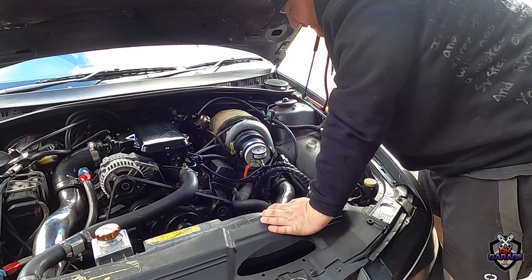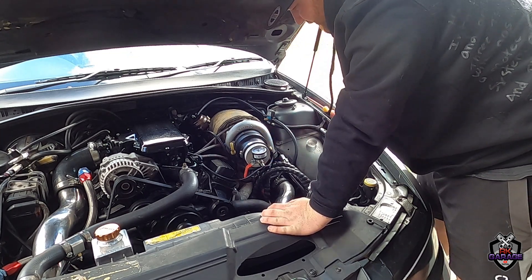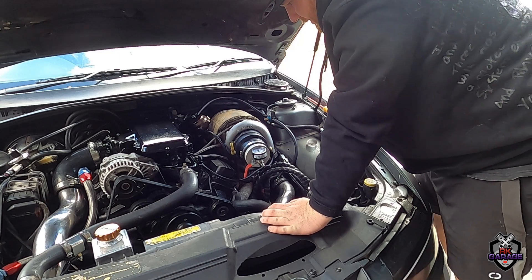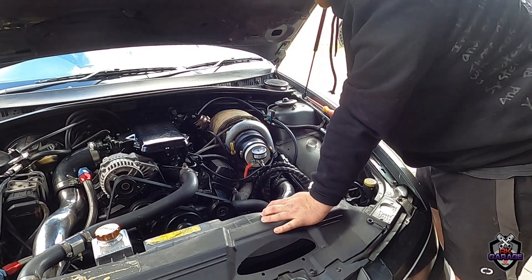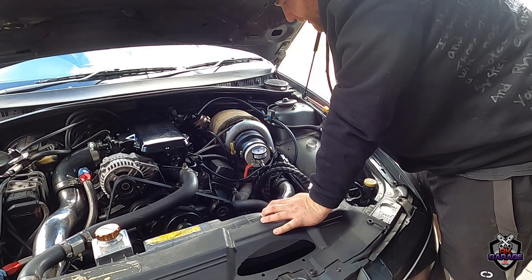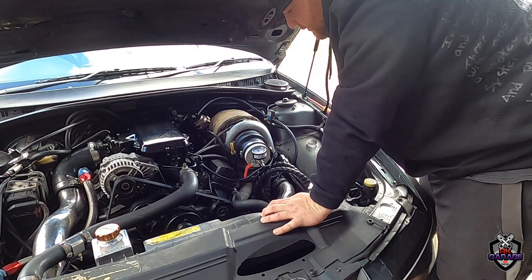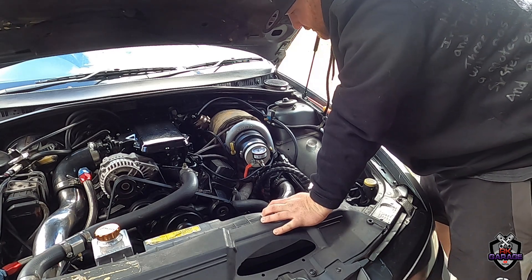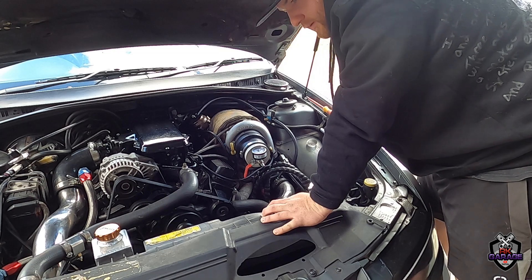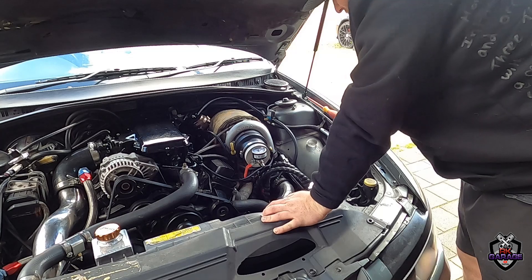Well, it didn't quite fit on nice, but with a bit of force it's staying on. So I'll get the compressed air and we'll see how much leaks through the throttle body and whatnot. The compressor's going to be real noisy, so for this bit I might just time-lapse it. So you guys don't have to hear all that — I'll get it all set up.